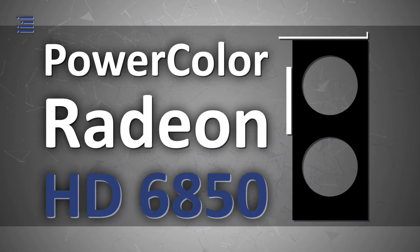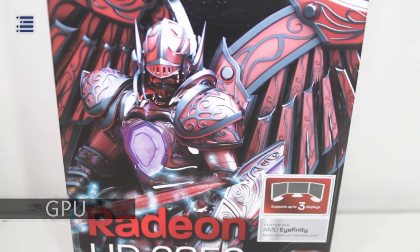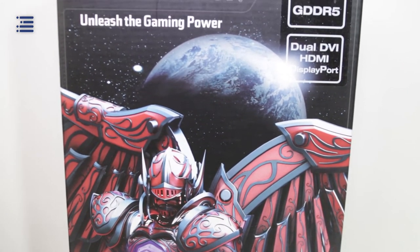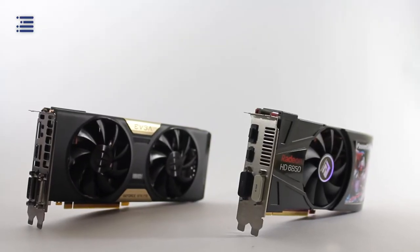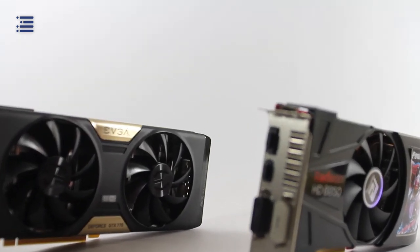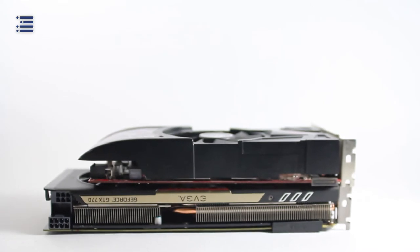The GPU is probably the most wanting component in the build right now, and it's probably going to be the first thing I upgrade. I'm currently using a PowerColor Radeon HD 6850 1 GB video card. It's able to output to 3 monitors without much issue, but I would like a newer, more powerful card with more compute power to help with all the Adobe programs I run. The most likely scenario will be the EVGA GTX 770 from the ammo can moving into this when I upgrade that to either a 780 Ti or 900 series card in the near future.